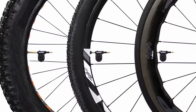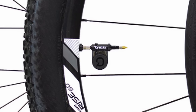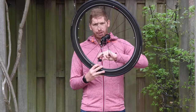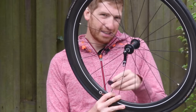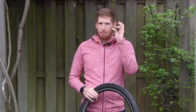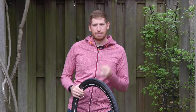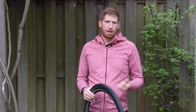This will work with pretty much any Presta-sized valve stem — and to be clear, it's valid with mountain bikes, fat tire bikes, any bike with a Presta valve. That's what a Presta valve looks like on your bike. If you get a flat in a race, you simply rotate this out like I did earlier — when the tire isn't inflated it's a lot quicker, about three to four seconds. You swap your tube like normal, but you'd need to reinstall the sensor afterward since it replaces the valve stem core — probably not ideal to spend time on in a race scenario.